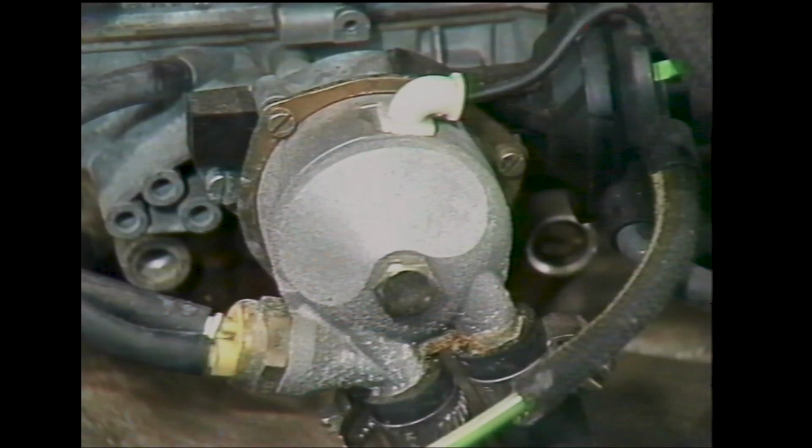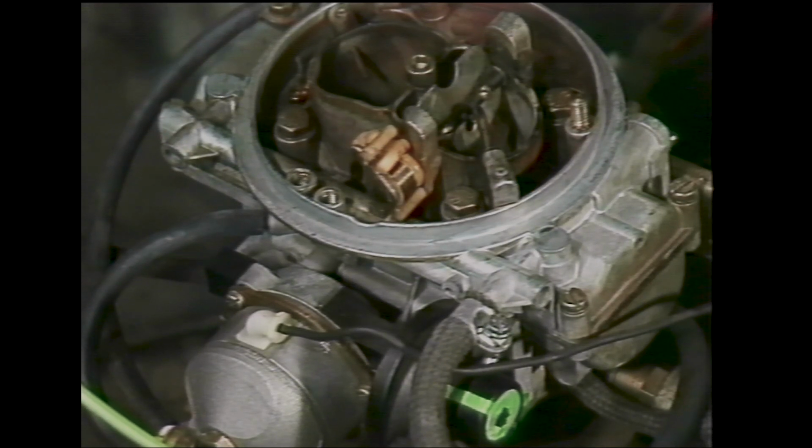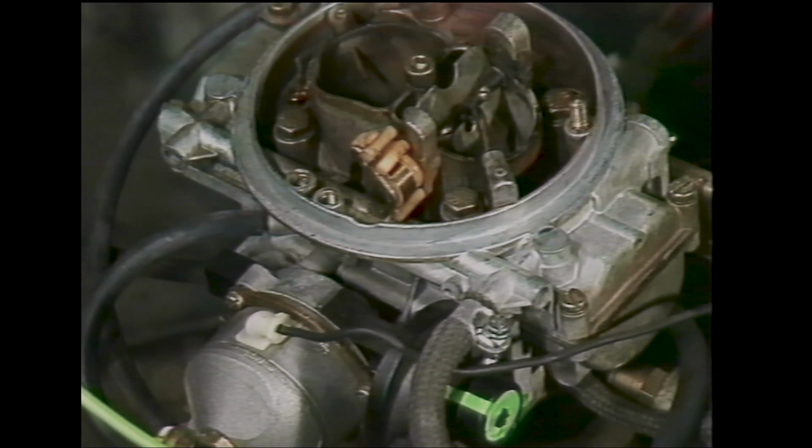As soon as the engine is started, 2 things happen. Firstly, an ignition-fed electric heater starts to warm the bimetallic spring, thereby gradually relaxing the tension. The tension is fully released after approximately 4 minutes, depending upon the ambient temperature and the speed of the engine warm-up.